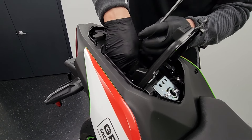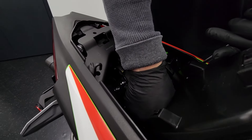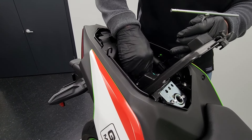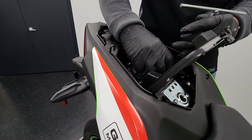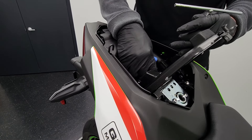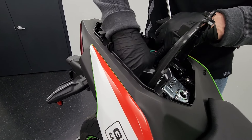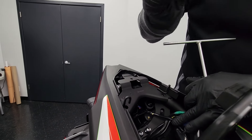Before I remove the fourth one, I'm going to disconnect these wires here — the wire for the tail light, you can just reach right down here and you'll see them. And then the one for each turn signal, and then one for the license plate running light. You'll see there's this little rubber grommet here — we're going to save this because we're going to reuse it.